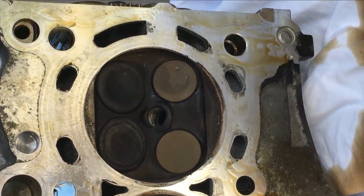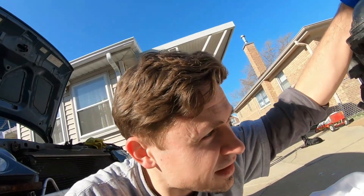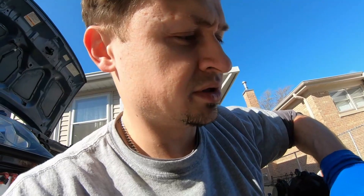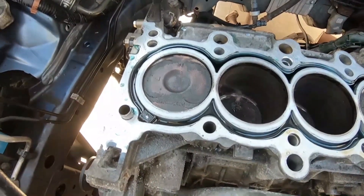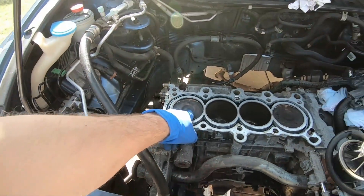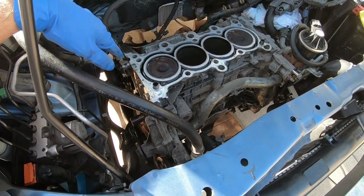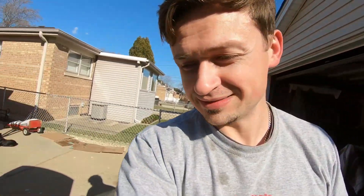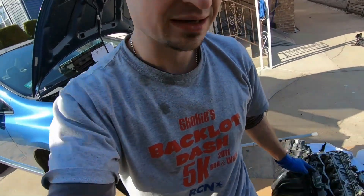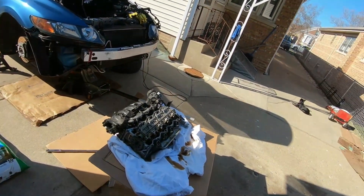It will need minor scrubbing to get a nice clean flat surface. I'm planning to test the deck surface for flatness with a flat bar and feeler gauges. I believe the maximum allowable warp is .008 of an inch. We'll definitely try to check for straightness on the head and probably the block as well. I'm debating whether I should drop this piston today. I wanted to plastigauge this piston first to check the clearance, but I'm not sure. This is all winging it, boys — and if I can get this far winging it, I think everyone can. Life is all about winging it. Hopefully she gets back in one piece and we can drive her as a daily.